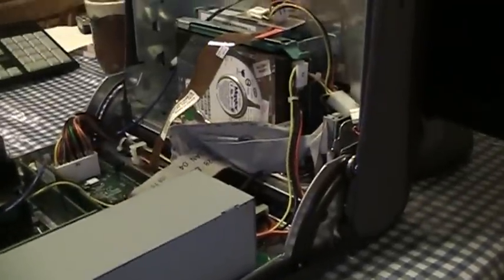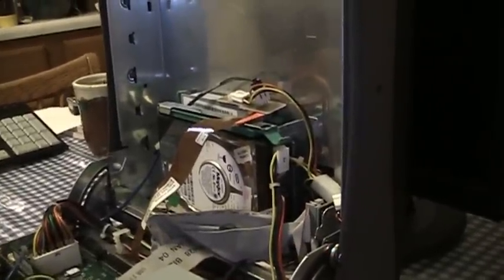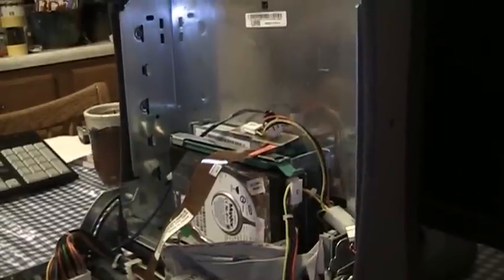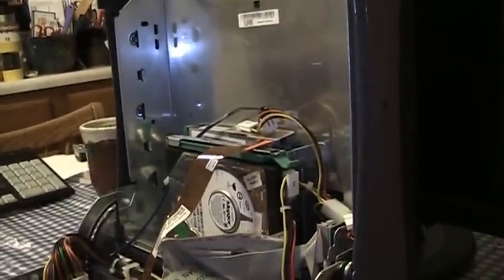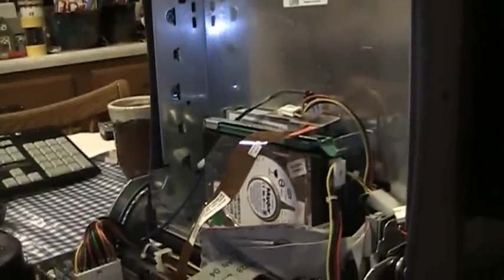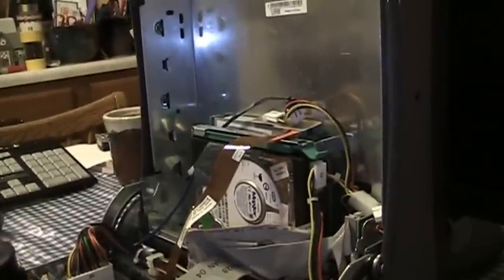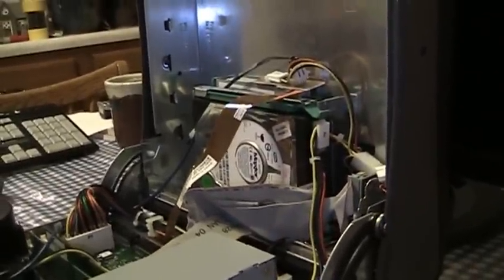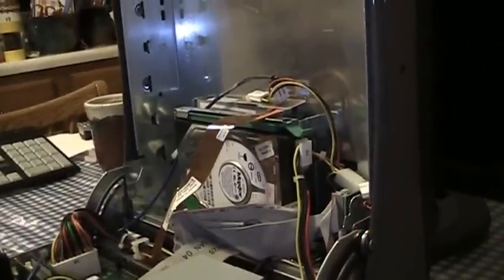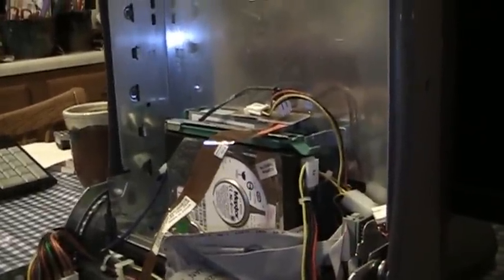Now folks, I have to tell you, even though I'm a huge nerd and probably the only person in the world, or one of a very few people in the world who actually cares about such a thing, well, I'm very surprised to see that there, because in my Dell Dimension 8300, Dell had already switched to delivering CD audio over the system's data bus, and that's all that modern CD-ROM drives support, which is kind of disappointing, really. But it works now. It didn't used to work very well. I can remember the earliest systems that featured that, and it really was kind of questionable, especially given that the bus really didn't have enough bandwidth to relay CD audio and hard drive traffic and everything else that had to go over it. It tended to result in stuttery, skipping playback, and it also resulted in the drive being spun up to its full speed because it was doing data extraction from the audio disk rather than decoding it directly and staying at a nice, quiet, single-speed playback.